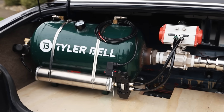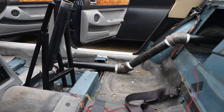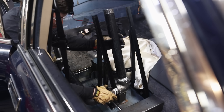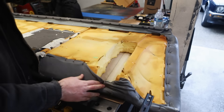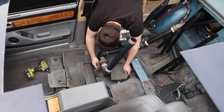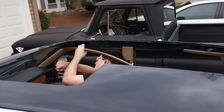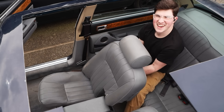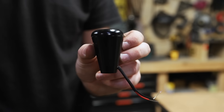I was concerned about the chair spinning around the cannon tube, so I made some guide rails that ran to the back of the chair and bolted to the car floor. The plumbing was pretty simple — a big air tank in the trunk fed through a high-flow, really fast-acting valve, and a bunch of two-inch iron pipe to make an air cannon. To route the plumbing into the cab, I had to cut out a pass-through. To transfer the force of the chair pushing back down on the tube when firing, I welded in a riser block to the floor that would support the bottom of the cannon tube. Once all of the major construction was done, I put back all the interior to make it look like just an ordinary British luxury car. And of course, it wouldn't be a James Bond ejector seat without a shift knob button, which I resin 3D printed.